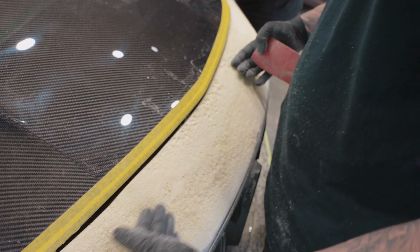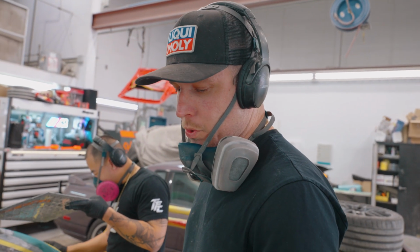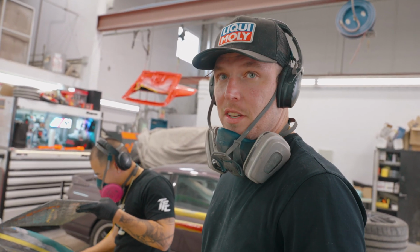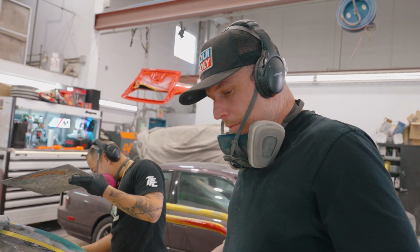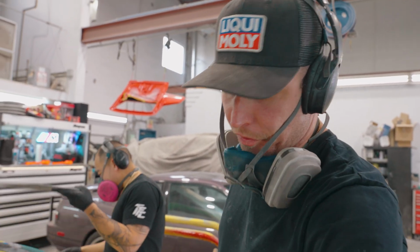I'm gonna bodywork this, it will be nice. And then I'm gonna lay this up in fiberglass. I'll put some mold release on here once it's fine-tuned, and then I'll lay my glass on here, and then I'll pop this mold off. And then I'll remove all of this. I'll probably fiberglass in the piece that I've removed on top, and then I will get rid of the existing stuff so we have the proper fitment to the hood.